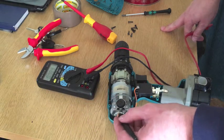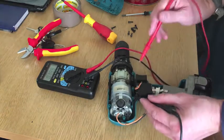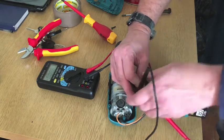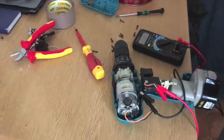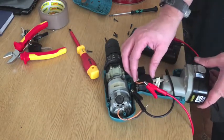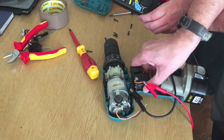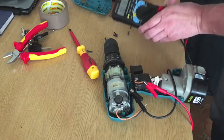So now, if you didn't have 12 volts there after you pulled the trigger, what I did was I cut these and tested here. I need to get some better connections. So I've got these better crocodile clips, and as you can see by pulling the button, you get 12 volts. It's just varying, dropping up and down, going to a low voltage. Basically, that tells me the switch is alright.